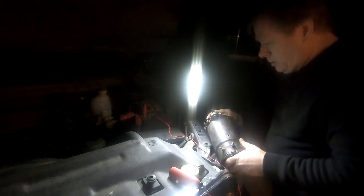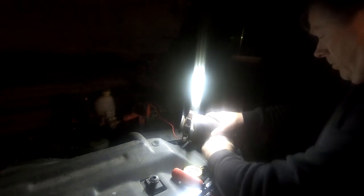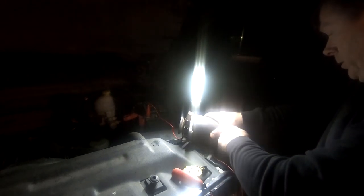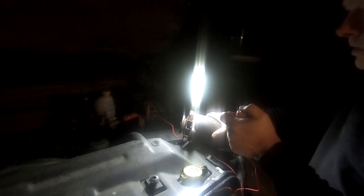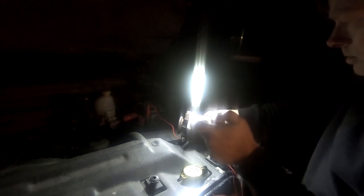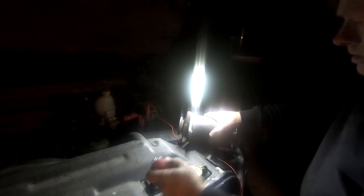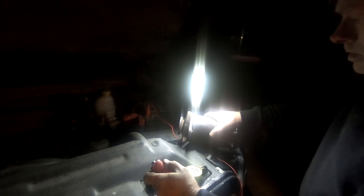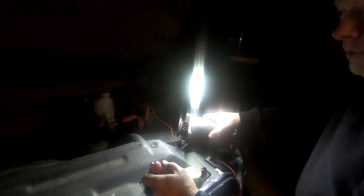There are two poles on here: one is for the armature and one is for the field coils. If I take the power from the battery on the truck and apply it to the armature, it should start this motor like any electric motor — a quick and dirty way to see if something's wrong with it. Let's try it out and see what we get. We'll ground this to the frame for our negative. There it goes — a little bit. Okay, so it's operating as a motor, although it doesn't have the torque I'd expect for a starter motor.